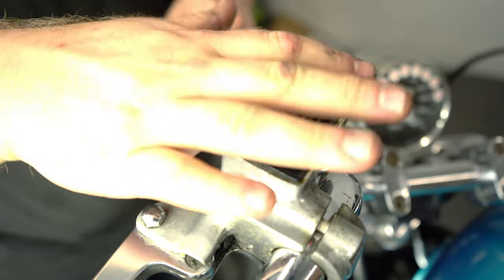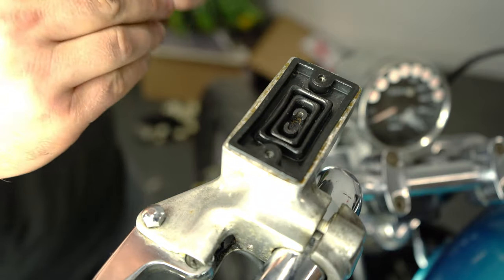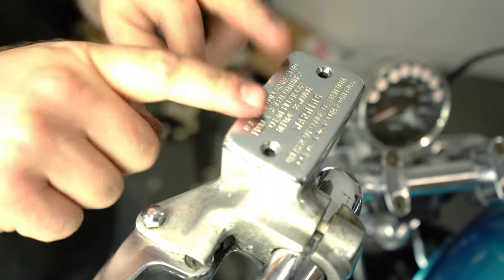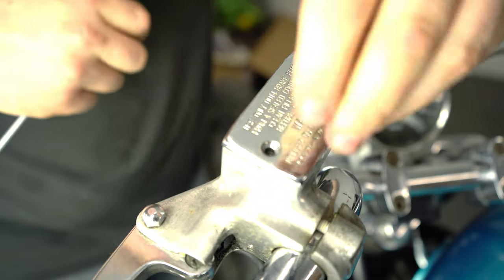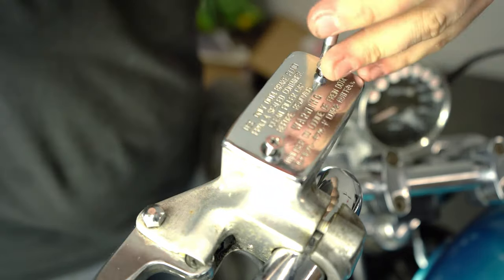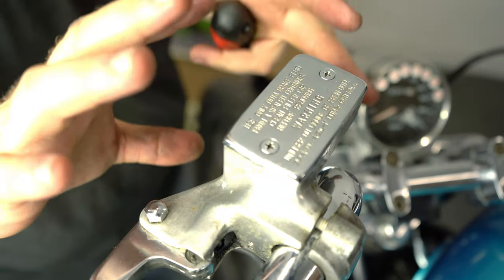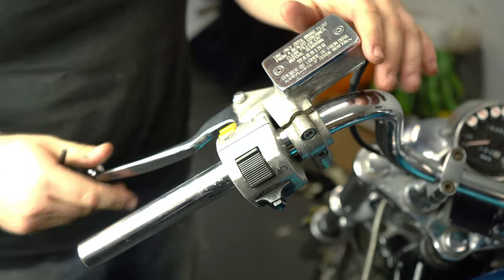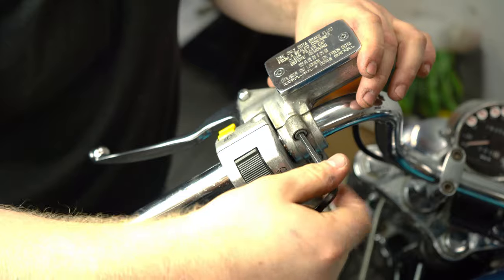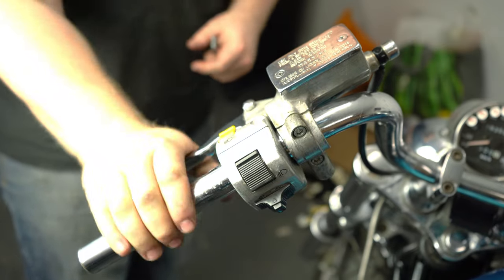The diaphragm, as I mentioned before, has to be replaced with those folds in the center collapsed - you don't want to extend them. Then we can put the cap on top and put the screws back in. It's a good idea to make sure the writing is facing the rider - that's just how they come as stock. Then we can move the lever back down to its normal position, throw a leg over the bike and put them in the orientation that you require. Give that clutch lever a good few squeezes - trust me, you'll know if that clutch is working.